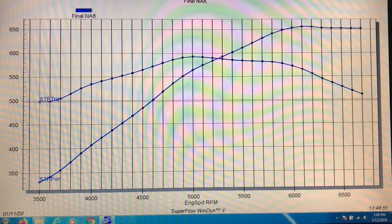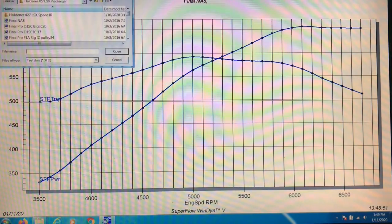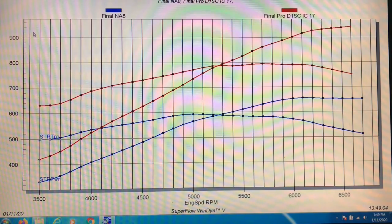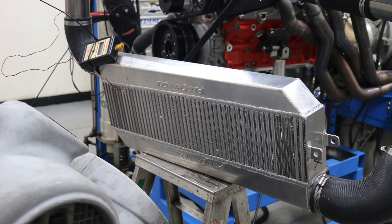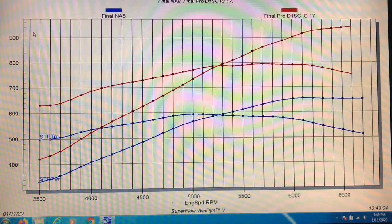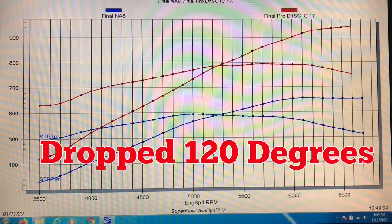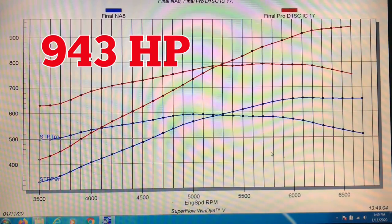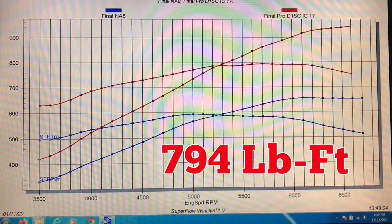Here's our naturally aspirated curve again: 656 horsepower, 593 foot-pounds of torque. Now if we add the ProCharger D1SC with their standard air-to-air intercooler core — 3-inch in, 3-inch out — we used a big fan in front of the air-to-air to simulate airflow. It might not simulate quite what it does out on the road, certainly more than at a stoplight but maybe not quite as much as at 100 or 150 miles per hour. But the charge temperature drops through the core were more than 100 degrees. So equipped with the ProCharger, the power output jumped to 943 horsepower at 6,600 RPM and 794 foot-pounds of torque at 5,700 RPM.